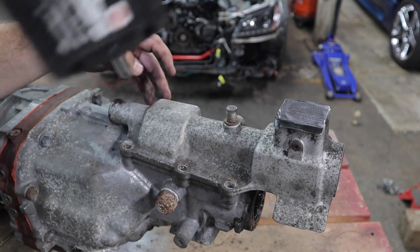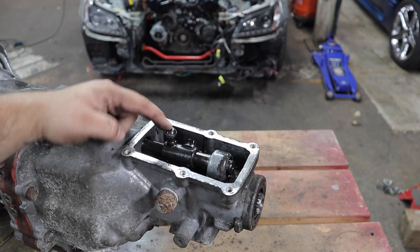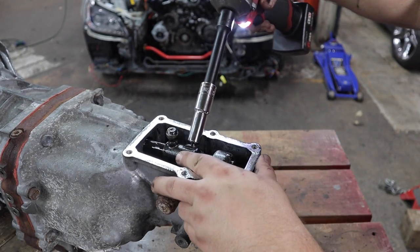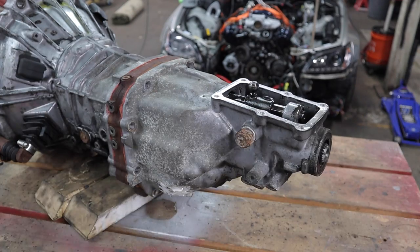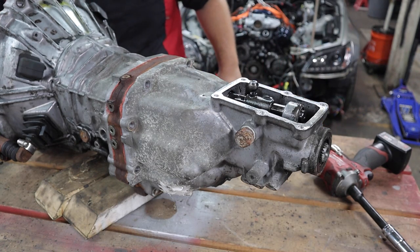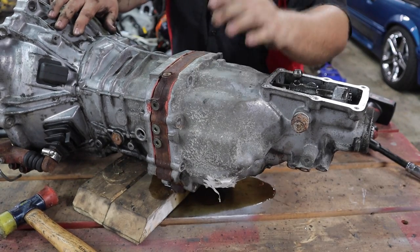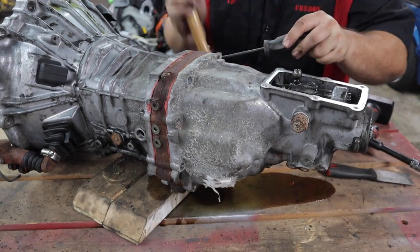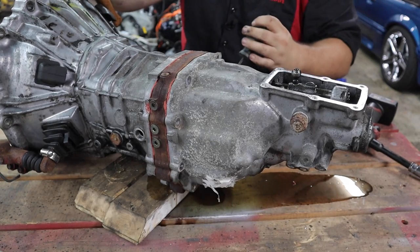I'll take off this piece and show you why it's a little more involved than you'd think. There's a bolt that secures it to the shaft, and to get it off, the whole rear housing needs to slide off. That bolt was a bit harder to remove than expected because of Loctite. This section is held together with RTV and not a gasket, so it's a little difficult to pry apart. Beware — when you do this you're going to spill a lot of fluid, so put a drain catch under there.